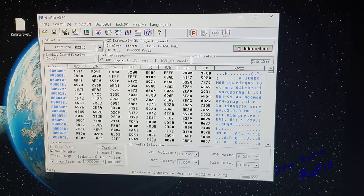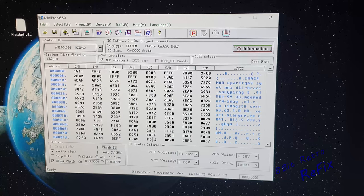If you were doing it for a 1200 you'd do exactly the same thing, except the A1200 has two chips - a high and a low. This is because it's a bigger ROM so there wasn't room for it all on one chip. Back in the day with Commodore it was cheaper to split it into high and low rather than use a single larger chip. I think it might be the same for the 4000, not quite sure, but if you've got a 1200 and you want to upgrade, you've got a high and a low chip and you just do it exactly the same way and pop them in.